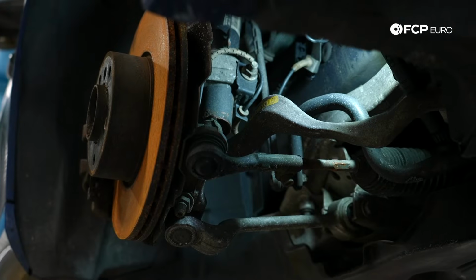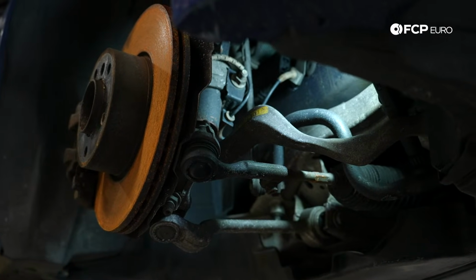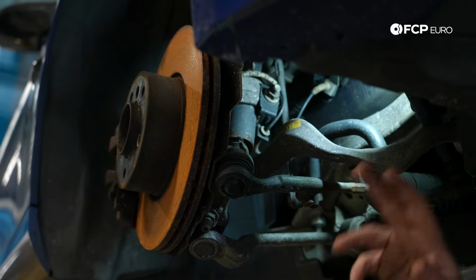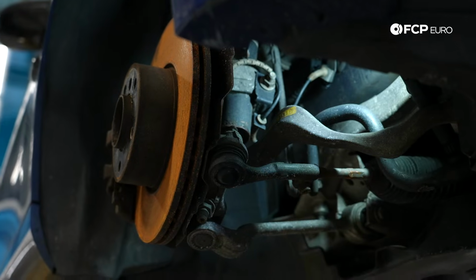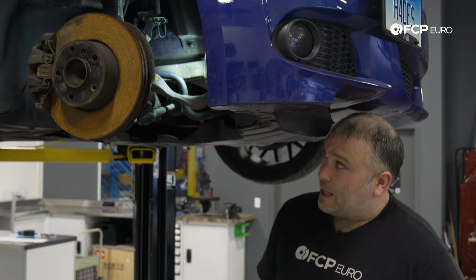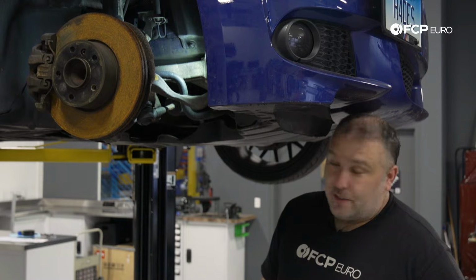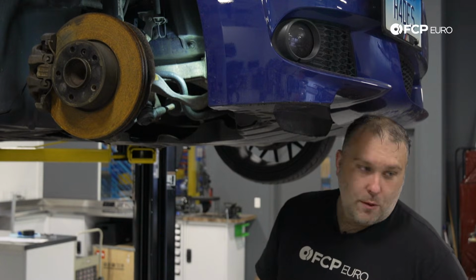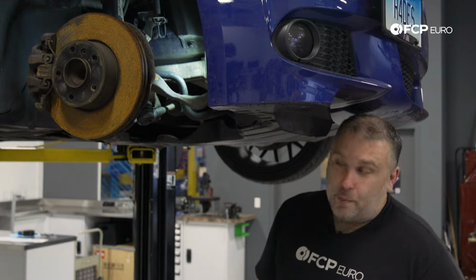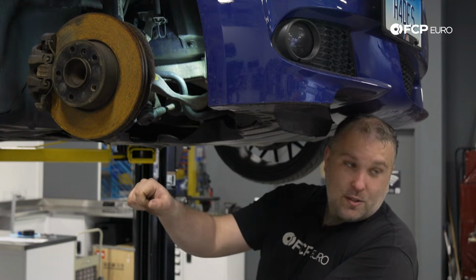All right, so depending on the car that you drive, all of this stuff here could look entirely different. So this being an E92 rear-wheel drive car, it's got a thrust arm, a wishbone, and a tie rod. In this car's particular case, the steering is definitely off, and so one of the common things that's going to happen on a lot of modern cars is if the steering angle is constantly out of range, or what the ABS picks up is out of range, your ABS and stability control will probably turn off, because if you need to constantly drive down the road like this, ABS will deactivate.